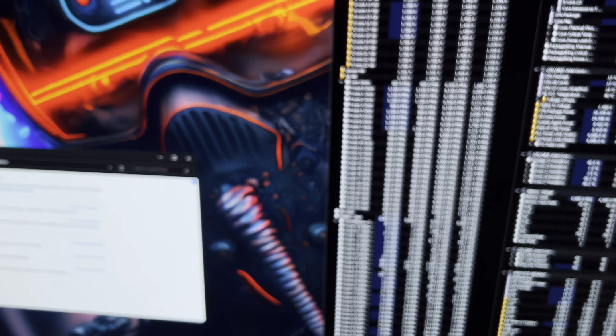This is a pretty extreme profile, but I just wanted to share my BIOS and what I'm running right now. But if I'm not running something like this, I'll run my CPU bone stock on LLC1, which is really low power, really easy going. The 13900KS is a beast right out of the box, especially with a good memory profile like this. That thing is just going to hammer games, right? Especially since most games nowadays are pretty GPU dependent with my 3090 Kingpin.